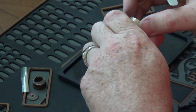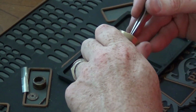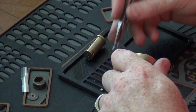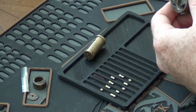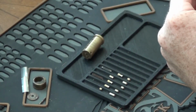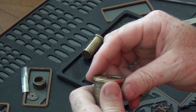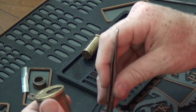Let's get the last 2 out. I got a spool in 5. No, those springs want to come out. And a serrated type spool. He's got work up top too. See if I can get these springs out. Steel spring in 5. 4 has a threaded chamber up there. Alright. There's a little copper spring. I pulled 3. 3 was super long. Oh, that looks like it came out of 2. A little short copper spring in 2.